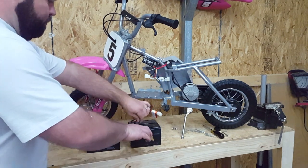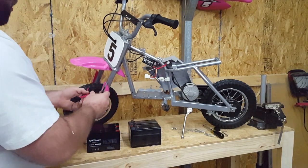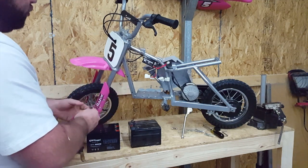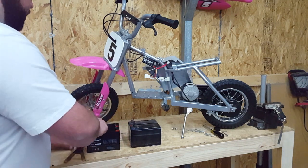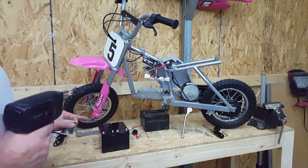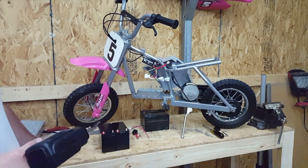Now what I like to do is go ahead and clip these off. While you have it clipped off, these will be removed. Now you have two different sections. The bike was 24 volts, so your black lead is going to go to the first negative of the first battery, and your positive lead will go to the second battery. Your fuse on these goes in the middle between your positive and your negative. My preferred method of working with anything toy-related — since the kids will probably be going over heels, maybe jumping them — is the more permanent method, and that's soldering.